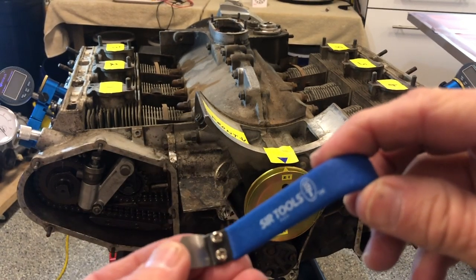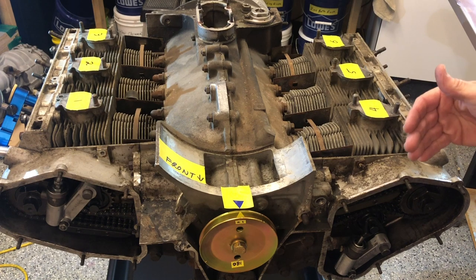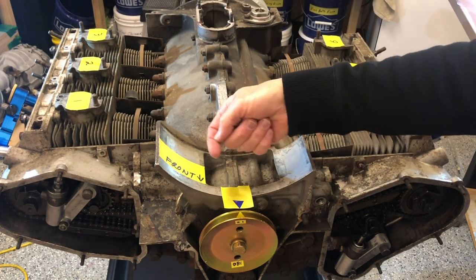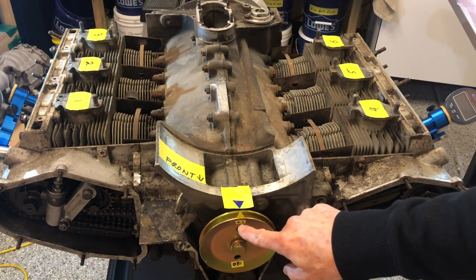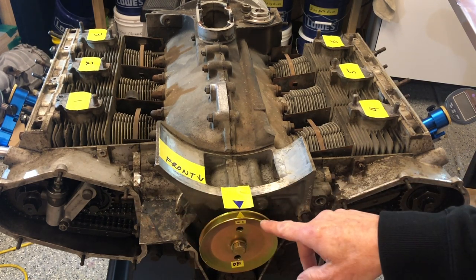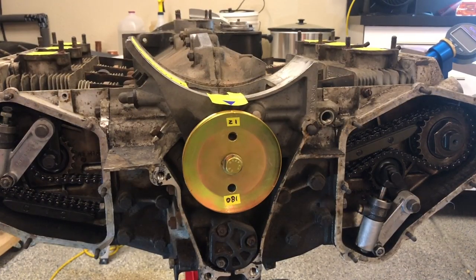Checking valve lash on these engines will require a special tool, which you can get from pretty much any of the suppliers. You'll also need to check the feeler gauge thickness spec for your particular engine. Let's orient ourselves with this engine while we're standing in front of it. Even though the front of the car is this direction, this is really referred to as the front of the engine. The crankshaft pulley here is stamped with a Z1 mark and a notch, which is a reference mark in relation to top dead center — it's going to relate to your camshafts left and right as we get further into it. For top dead center, that needs to line up on your case halves — a very important reference mark throughout the build. Looking at the front here, this is going to be referred to as our left side of the engine and this is the right side.